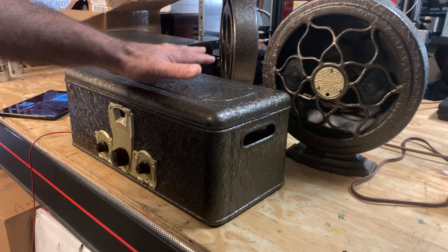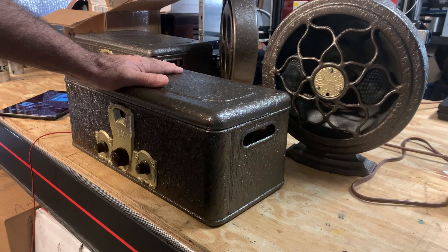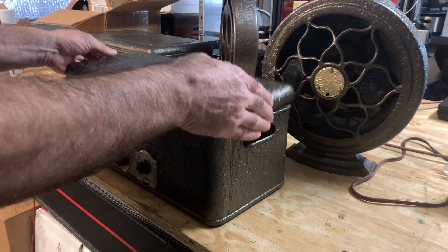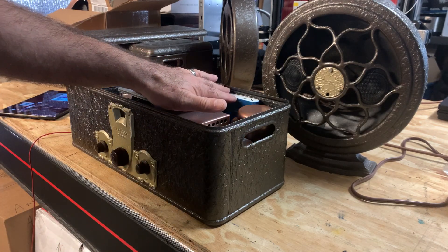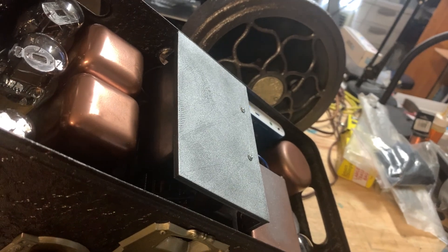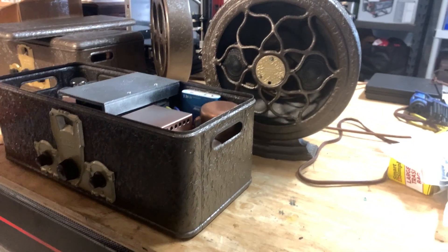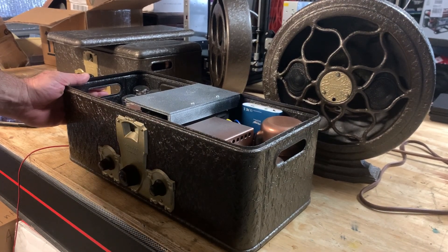The original unit operates with the original speaker by itself, but there's a separate Bluetooth system that runs to these stereo speakers. I had told you about the issue of the large transformer for the Bluetooth unit, and thankfully I was able to put the transformer below the hood here, right above the tuning condenser, out of the way and out of sight, so it has a much better look than having the transformer exposed.